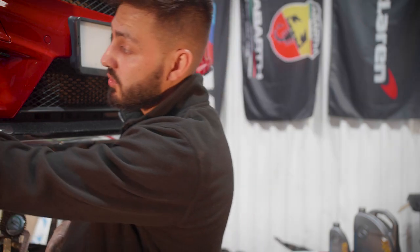Right, so I have checked all the bushings, the control arms, the tires, the brake pads, the brake discs, and everything else that is accessible on the ramp. And everything is in good condition, apart from one of the air ducts is missing from the brake discs, which is a cooling feature for these cars. The air goes through these grills and it cools your brake discs. But that pipe is missing, so I will be replacing that in the near future.